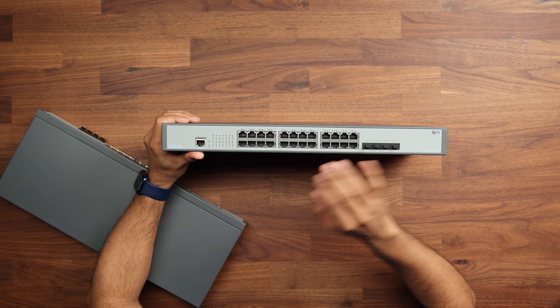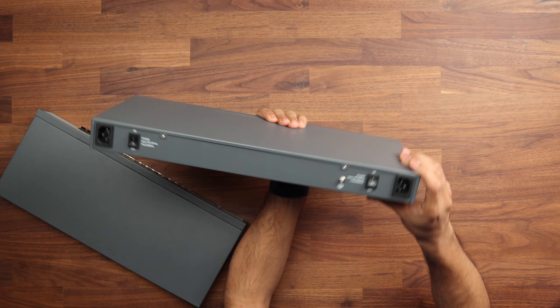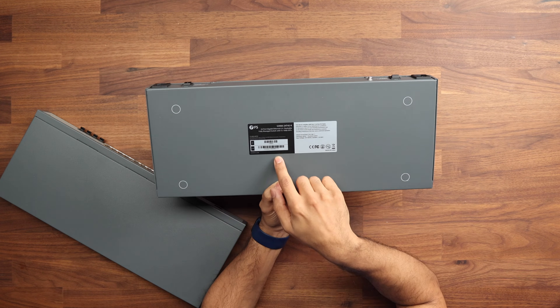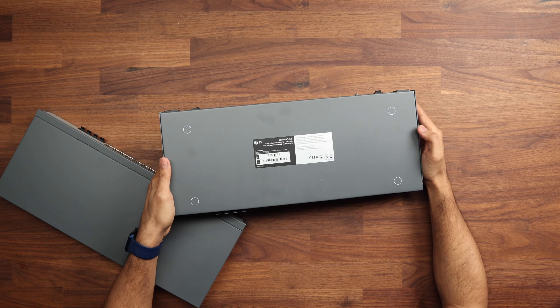Back to the two switches in front of me — we have a bunch of different connectors which I'll go through shortly. These are 24-port 1-gig switches and they have four SFP+ ports. SFP stands for small form factor pluggable. There's also a console port and dual power supplies. The model number is the S3900 — links are in the description below along with the username and password to access them.